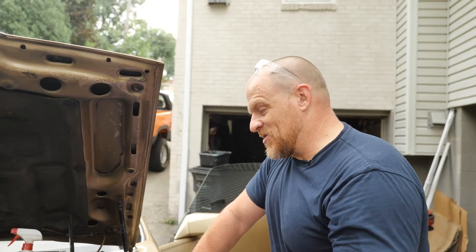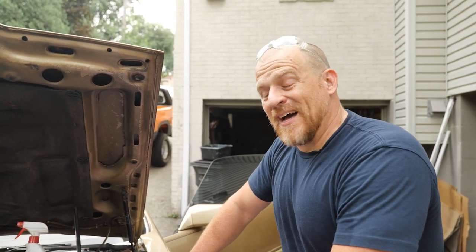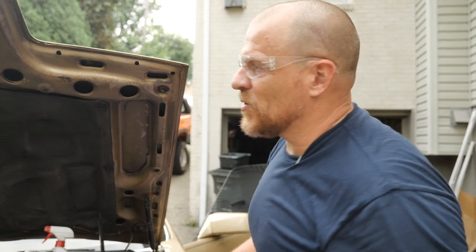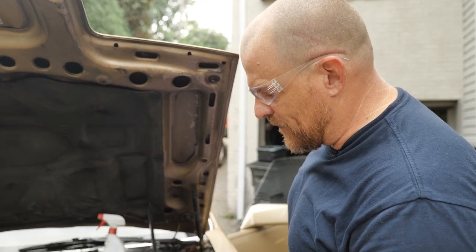Now, this job and where we are, to spend $50 on a compressor, I'm happy about that. And it's the same day and we can get this car done, get it out of here. It's an old car. All right, let me put some more nitrogen in this because I want to do one final pressure check. And this time I have my micron gauge removed.